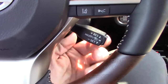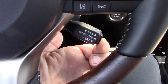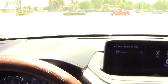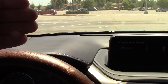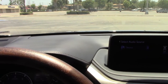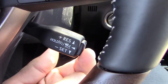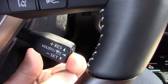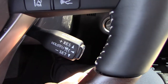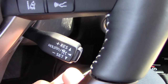For the dynamic radar cruise control, if we push this button on the end of the little stalk, that turns the system on and we see right here: radar cruise active, please pay attention to other vehicles. What the radar cruise control does is it can lock on to the car in front of us and maintain a distance from that car. Because this is the all-speed dynamic radar cruise control, it can bring the vehicle to a complete stop. You'll notice it says 'hold' with a little picture of a speedometer — if you push and hold that button, you turn the regular cruise control on. So we're just going to push it one time briefly to turn the radar cruise control on. Once we're on the move, we bump that stalk down to set our speed.